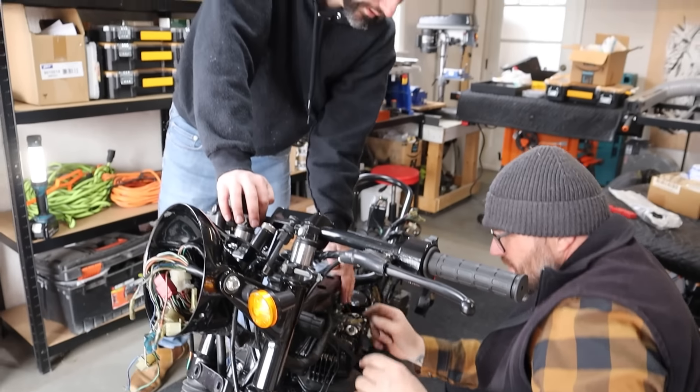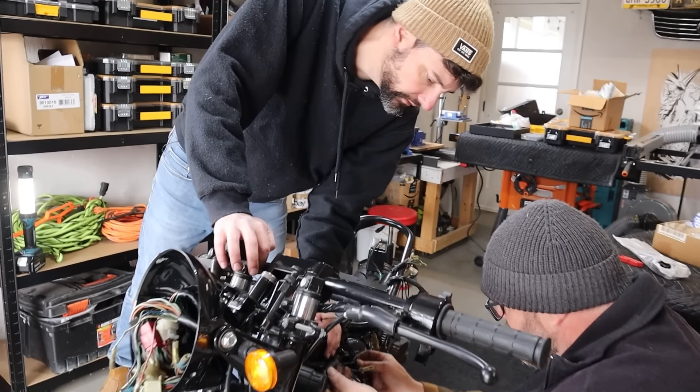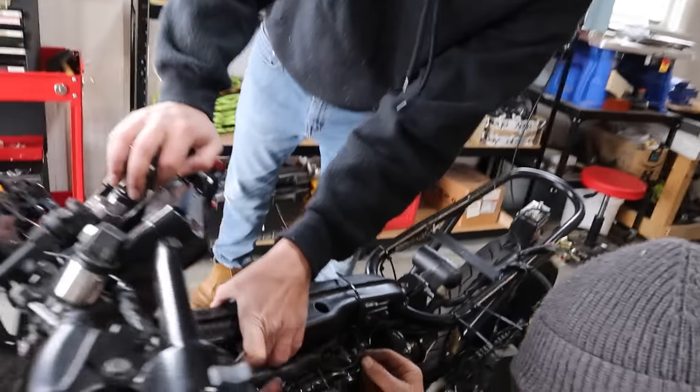There's a ground here. Does that just ground off to one of these bolts? It should, but it's too short. There's got to be somewhere. I have this blue wire and I thought maybe I'd find its friend somewhere and I haven't found it yet. Is that blue wire this blue wire? That could be it — yeah, that's it. Fixed it, problem solved. We're going to see what the book says about a blue and red wire. It's the oil pressure switch — blue red. Do you have an oil pressure light anymore? No, everything's off.